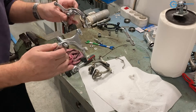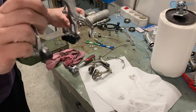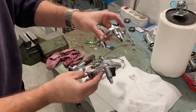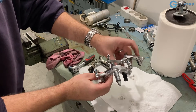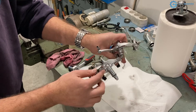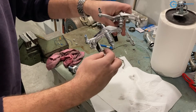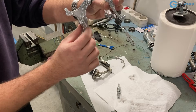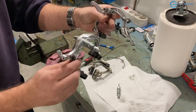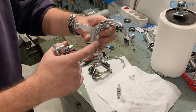I started recording after I had already disassembled the old brakes, thinking it might be useful, so this is what they look like when assembled. I have a front brake — the one on the bottom with a longer screw — and the rear brake, which has a shorter screw for mounting because it doesn't go through the fork, which is usually thicker. The rear ones are usually mounted on a steel plate. The part I put down below is what was damaged on the old brake, which I took out of a new Chinese brake of poor quality.